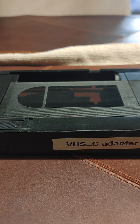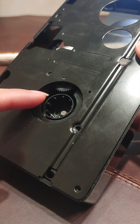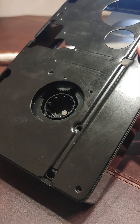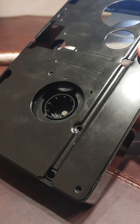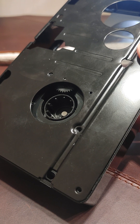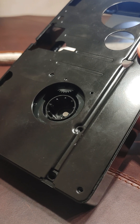The first thing you need to understand is the mechanism. If you see on the back part a plastic piece that is covering half of it, don't put it into the VCR — it's just going to spit it out and make things worse. So if you see a plastic lever in the middle, that's when you know you need to stop.